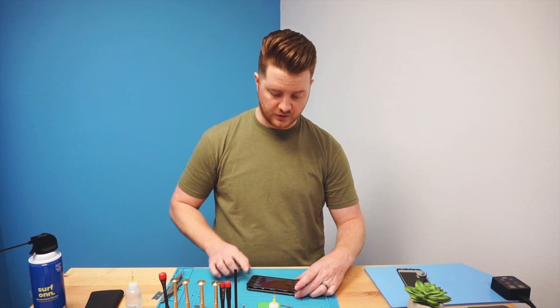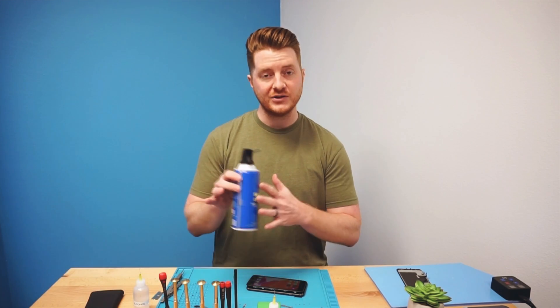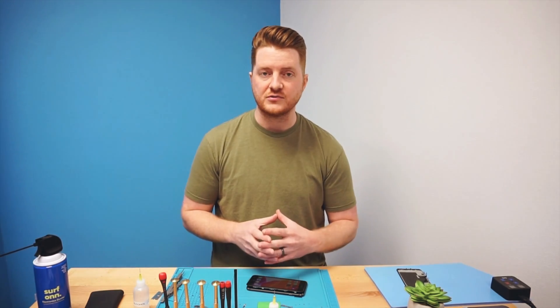So in the case where your home button doesn't seem to work after repair but the double tap to lower the screen does, you've probably waterlogged your home button with a little bit of isopropyl alcohol. Don't stop using isopropyl alcohol — just add into your screen repair process a little blow on the back side of the button with some canned air to clear it out. That will prevent frustration and also prevent you from pulling four or five screens off the shelf and risking damaging the home button by transferring it multiple times, when in reality it was most likely just a little bit of isopropyl alcohol in your home button.